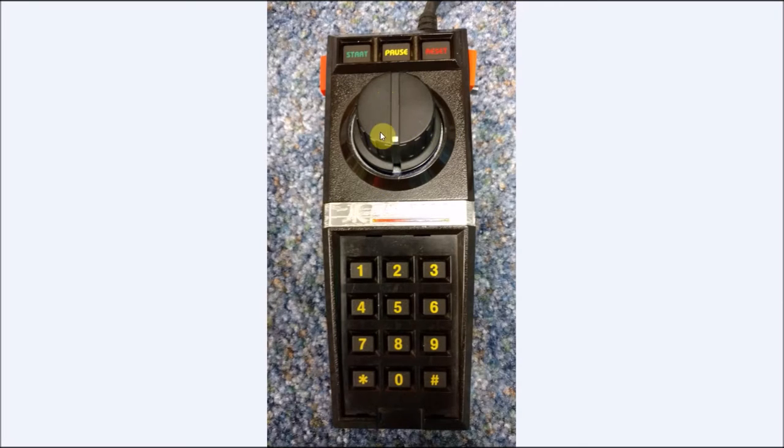This again is the lower potentiometer I'm stealing the wires from, but over here I added a resistor and a switch that'll connect to the upper potentiometer from my high low gears for Pole Position, which is what this video is all about. So I went on eBay and I got a non-working 5200 joystick.